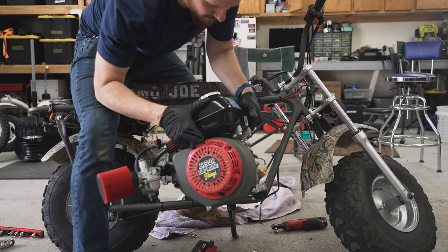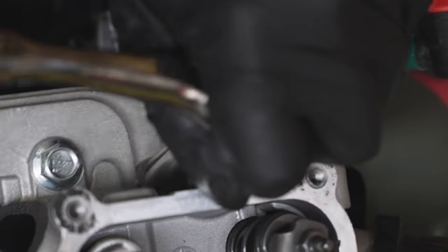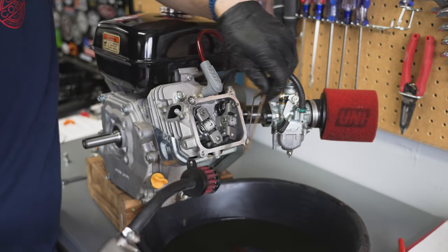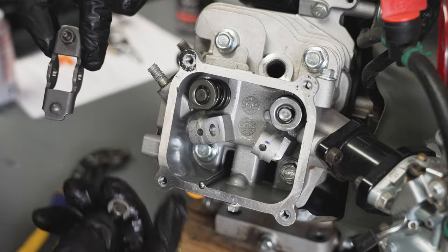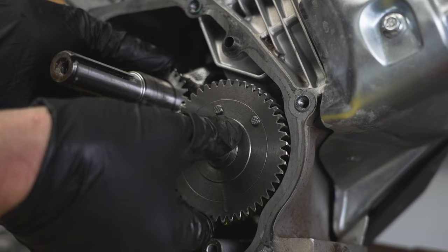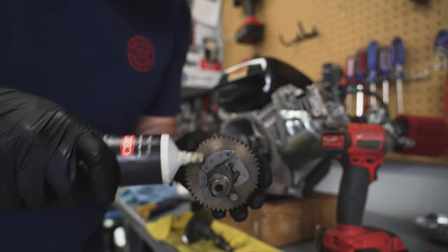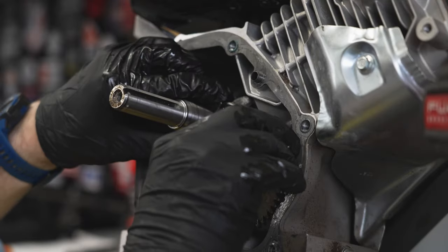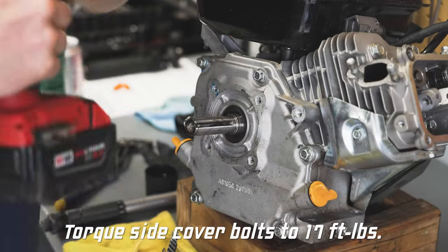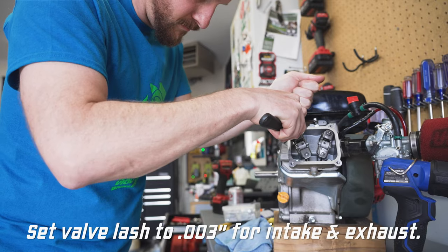Let's start by breaking down the bike to upgrade our camshaft. To do this, you must drain the oil, remove the spark plug, don't rip the gasket, remove the valve rocker arms and push rods, then remove the engine side cover, and remove the camshaft. Make sure the valve tappets stay in place. Lube the new camshaft and install it by lining up the timing marks. For a detailed Stage 2 race engine step-by-step build guide, watch the video linked above. I reassembled everything and adjusted my valves.